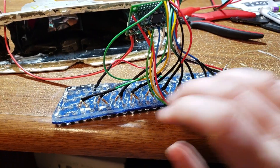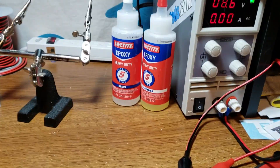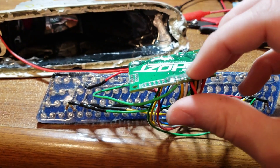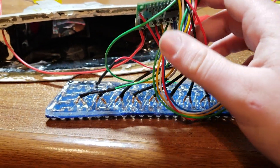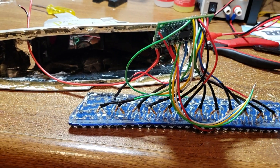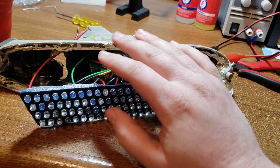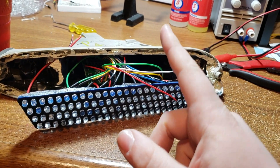That's the gist of it. As you saw earlier, what I did was fill in the back side of the LED panel with epoxy — just some two-part epoxy from Loctite. And then I added a little bit of epoxy to the back side of the ghost module after I soldered in all the connections for the outputs. That should just kind of help with accidental shorts — there shouldn't really be any reason anything would make contact, but if something were to happen, that epoxy gives a little bit of extra protection. I'm getting really excited to see these things done and have them on my car. Once I get this finished I'm going to have to do a whole other one, but definitely pretty stoked for it.